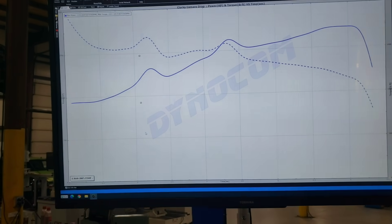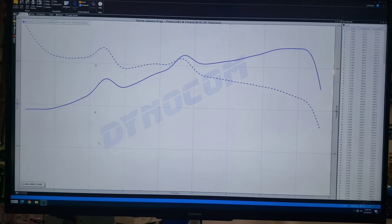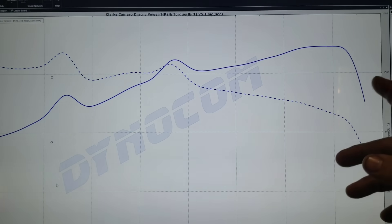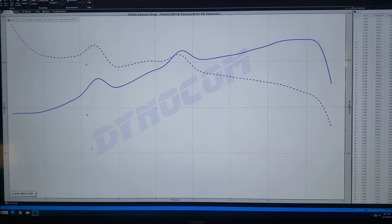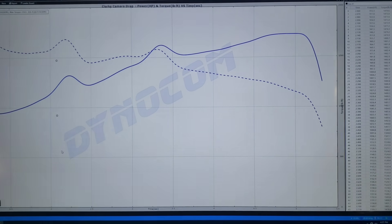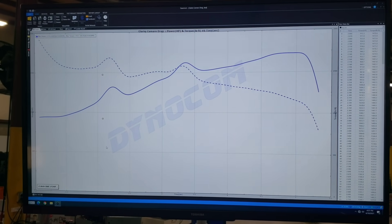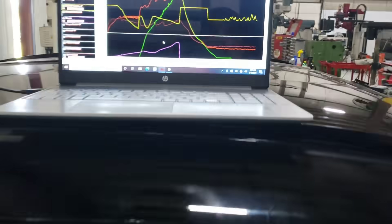You can hear how long that pull was — six seconds from the release of trans brake. This car is maybe a little bit fast but I can slow that down some more. We can see how much horsepower it made. This is in a low-boost form — 1,725 horsepower right there. Like I said, this is low boost for this car. We make 30 pounds of boost on gasoline, and on methanol we can make more — up into the 40s or even 50 pounds of boost, or 60, 70, 80, 90 pounds on the SMX engines.